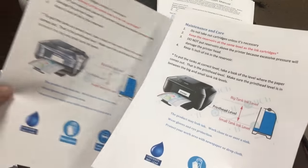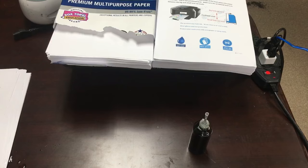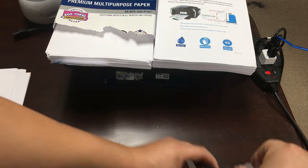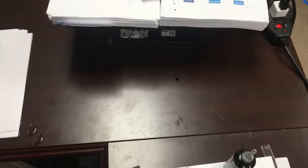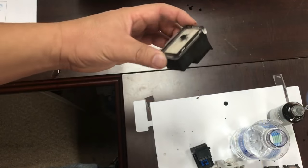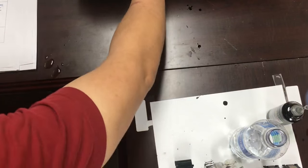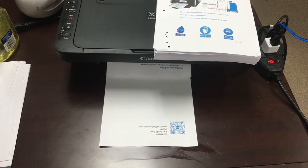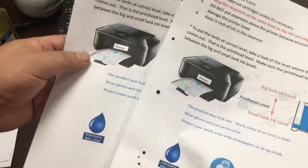We are going to add 10 millilitres of ink into the black cartridge and make it print the same quality as the last good copy. Adding 5 millilitres each time, we also used a priming syringe, puffing 1 millilitre of air to help the ink go to the bottom. The result is as good as new.